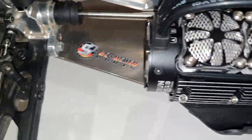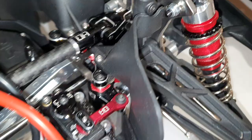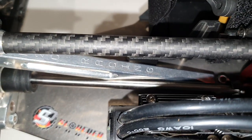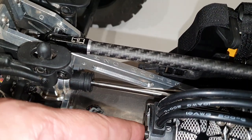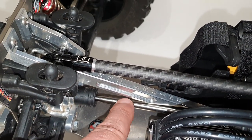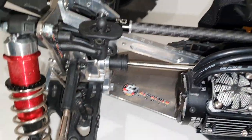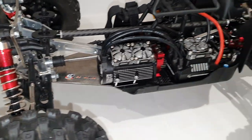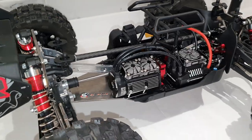He made quite a lot of bits that are on this. He's got the chassis top plate, and the drive shafts — the centre shafts in there. They're a whole lot larger in diameter than the steel ones, so they don't wobble and flex under high revs. This drive shaft — if the motor's doing 50,000 RPM on about a 3-to-1 ratio, you're still getting 17,000 RPM into what was quite a thin steel drive shaft. They're never perfectly centred, so you do get a wee bit of wobble that gets amplified the faster it goes until they end up hitting off the surroundings.